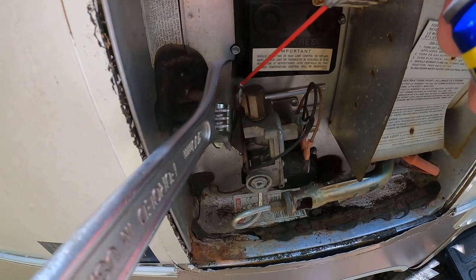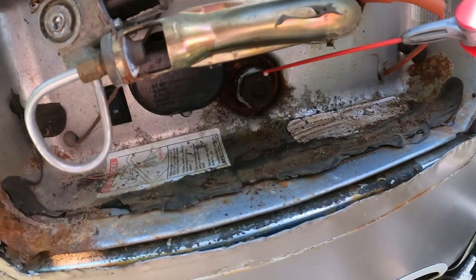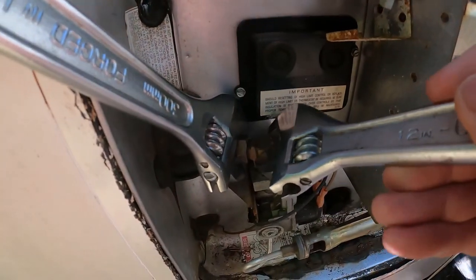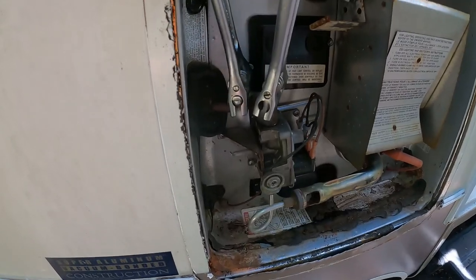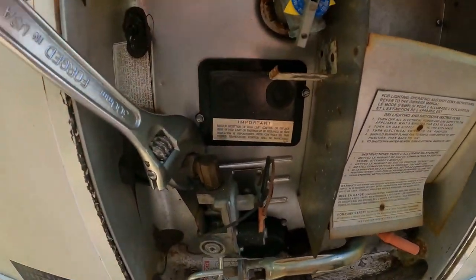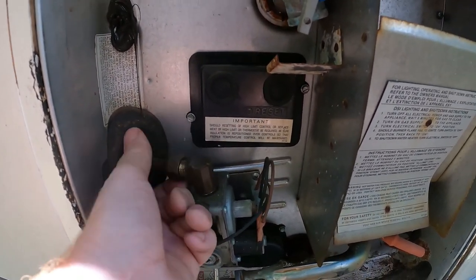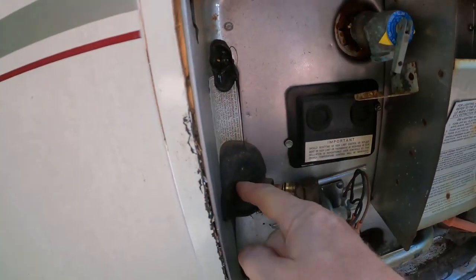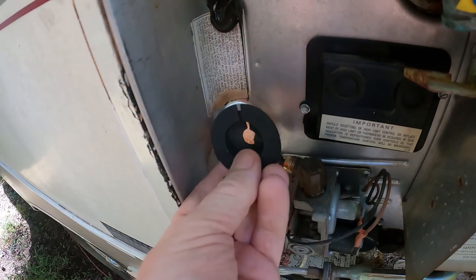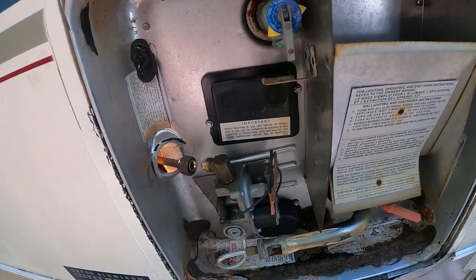I'm going to put a little bit of WD-40 on here, and more down here on this sacrificial anode because I'm going to pull it out and take a look at it — just to see what shape it's in. I used this one to support it and just pulled this one back and it broke free, no problem. I just didn't want to damage anything here with this solenoid — this unit for the gas metering. Now I can pull this goop off here so it can pull through. Underneath was some type of grommet gasket and then goop on top of that.